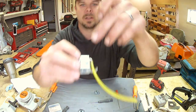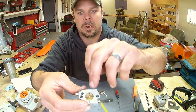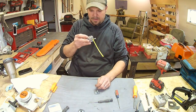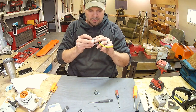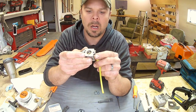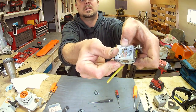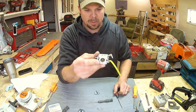As the vacuum pulsing causes this diaphragm to go up and down, that hits right here on the backside of the lever for the needle and seat, which causes this to go up and down. Which in turn causes your needle to go up and down in the seat, which goes through a bunch of orifices in here. It's coming in this way, fills up this compartment, and then goes through the metering system.